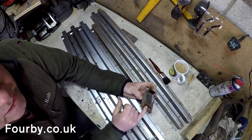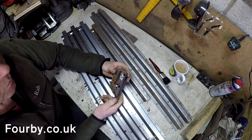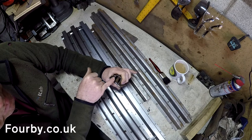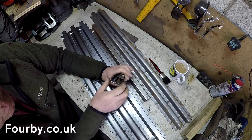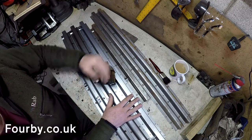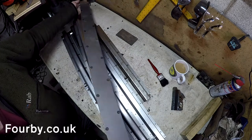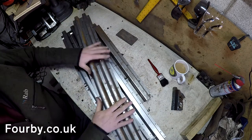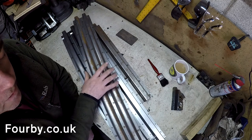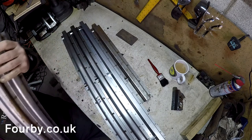This is the original section of the door, and as you can see it was all rotted away, which is why we wanted to cut it out and replace it. The first thing I want to show you is the cross-section here. If we look carefully at the radii and feel them with our fingers, out of the potential repair sections I've got here, I'm going to take these two and discard them — these aren't Defender repair sections. These are good for Series Land Rover doors or the Safari door on the back of a Defender; the profile is incorrect for Defender doors.